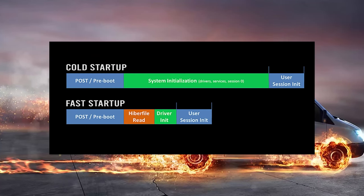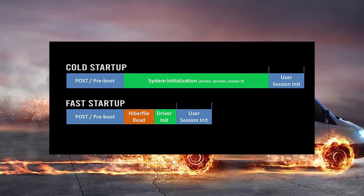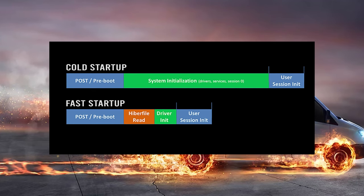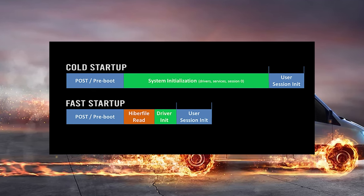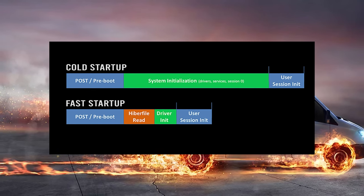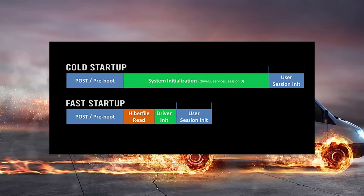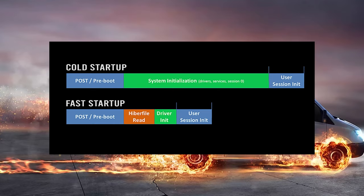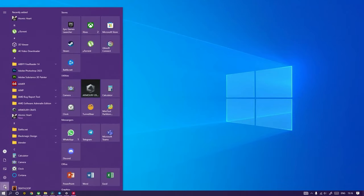It's all about the fast startup technology, which, when you turn off your machine, saves the state of the system kernel and drivers to the hibernation file, so that it loads faster the next time it is turned on. The function is certainly useful, but it can also harm stability. After all, if there was some kind of failure in the system, it will be saved to the hibernation file as well and will be restored at the next boot up. Thus, if the stability of your system is more important to you than some couple of seconds saved when booting up, you can safely disable this feature.